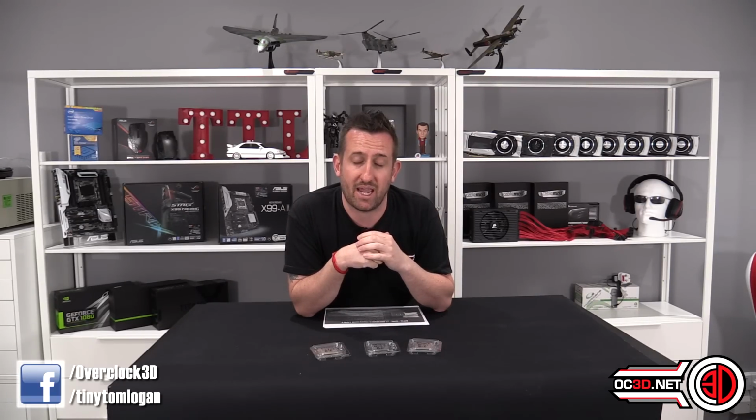One of the things I would say is if you've not done it before, it's a scary place to be, but the BIOS is the easiest and safest place to do it. If you do go into the BIOS, you can just go to the tools and you've normally got a little flash bit of software in there somewhere, and it's just as simple as downloading the BIOS from online, from your motherboard vendor website. Put that file, and only that file, on your USB drive, pop it in one of the little connections at the back. Bob's your mother's brother. It really isn't that difficult.